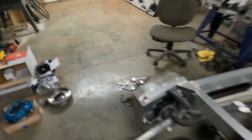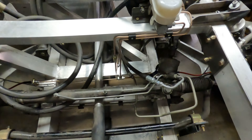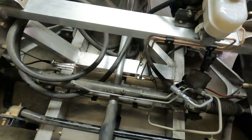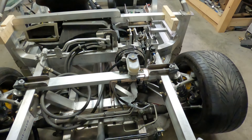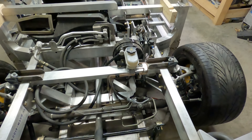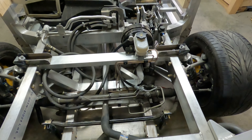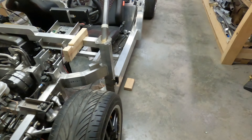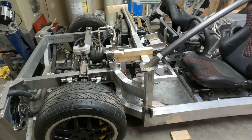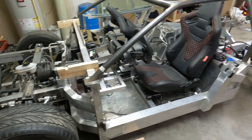The front was leaking in a couple of spots — actually three spots. Two of them were because I'd never tightened the fittings tight, and one I just don't think the fitting was tight enough. With the help of my wife, I believe we've stopped all of the leaks. I now have brakes. All of the air has not bled out of the brakes, but it's pretty good — not perfect, but good enough for now. If this front brake fitting is still leaking in the future, I can get to it easily to change it out or tighten it. For now, it seems like I have brakes on all four corners.